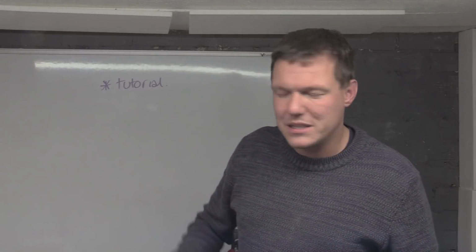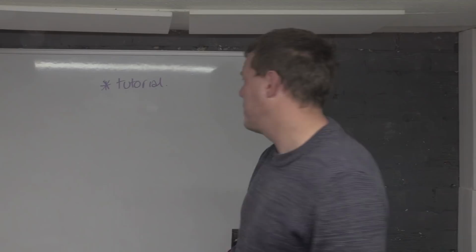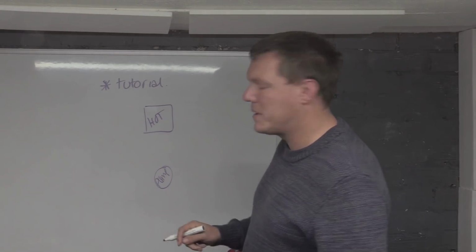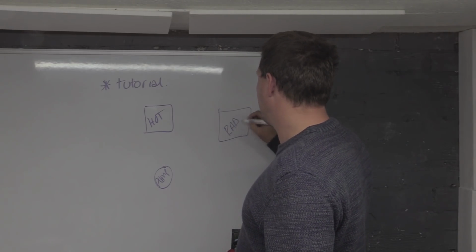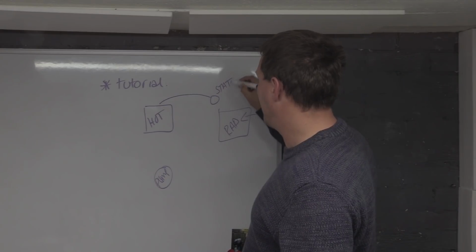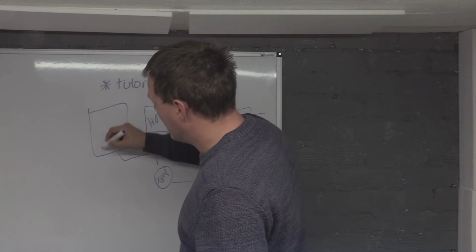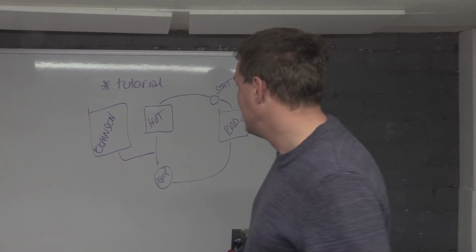Thermostats, expansion tanks, radiators, all of these things, it's extremely simple. You have a hot thing, right? There's a lot of waste heat. You have a pump down here to move it, because basic convection currents just aren't quick enough. You have a rad that requires air to flow through it. It goes from there through a stat to your pump and in there. It's basically that simple. And then anywhere along here, they just add an expansion bottle, and that's for, well, expansion, weirdly enough. It's written on the bottle.